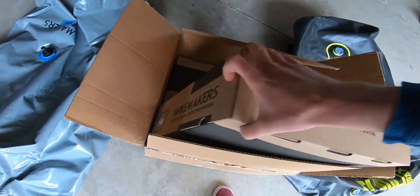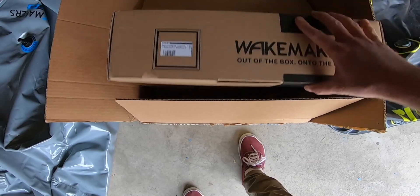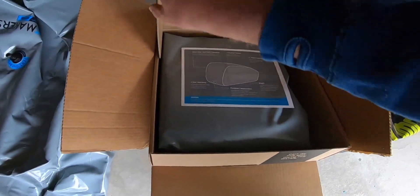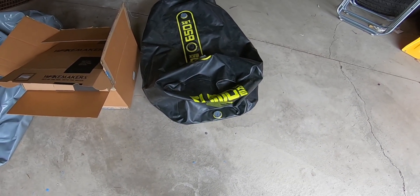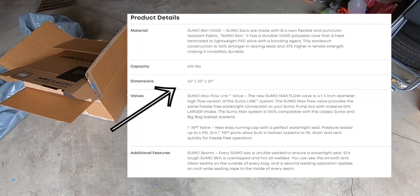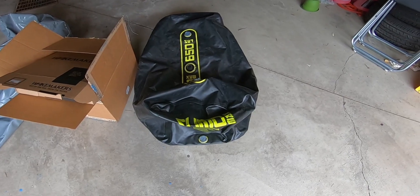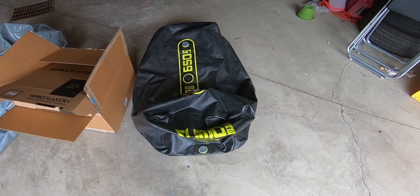The new bags are the 550s — definitely about 300 pounds less weight. I also have some old Sumo 650s from my last boat to test. With Sumo you do need to be careful with the weight because if you measure out the bags — for example, 20 by 20 by 40 inches — you multiply those to get cubic inches, then multiply by 0.0361 to get the total weight. I find Sumo bags are often not as heavy as advertised, especially bow bags.